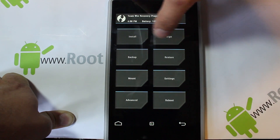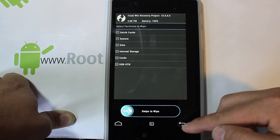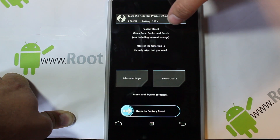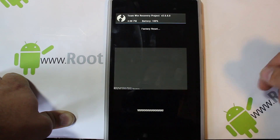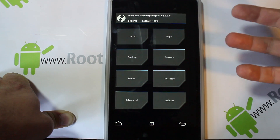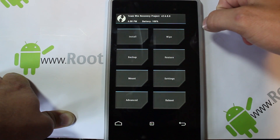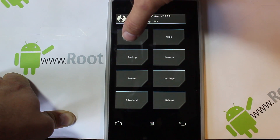We're going to go into wipes first. You can go to Advanced and pick specific wipes, or you can just do the standard wipe, which wipes the items listed at the top — normally that is good enough. So we'll go ahead and slide it across. Now you have a clean slate to flash your ROM. That wiped factory reset, Dalvik, Dalvik cache, and cache. Now we go to Install.